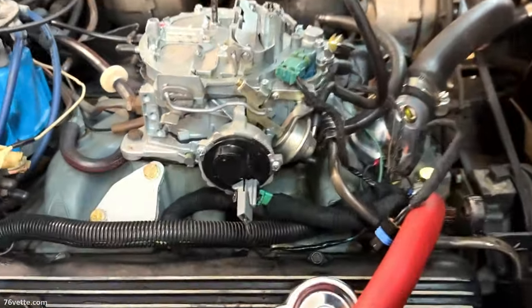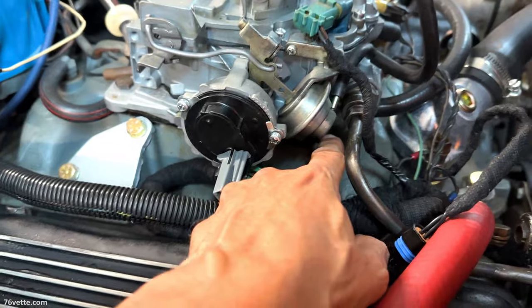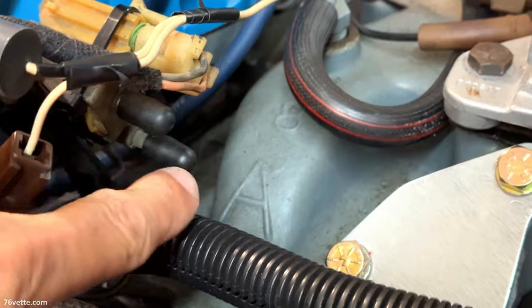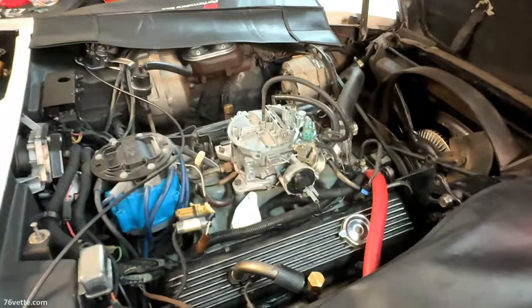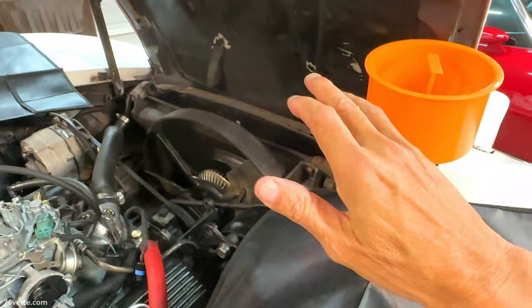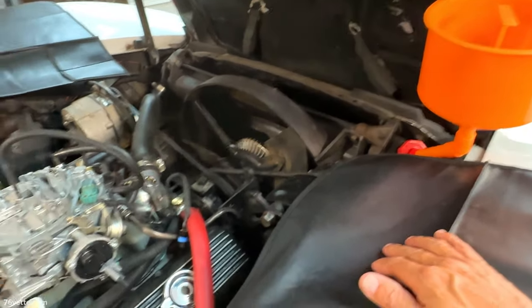Keep in mind also, if you decide to eliminate certain things like vacuum systems and stuff like that, you're gonna have to plug the carburetor and any other ports that may have an effect on how the car idles or performs. Alrighty, so in the next video, what I plan to do is to actually perform the actual cooling system flush. We'll get as much of the gunk out of there as possible.